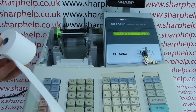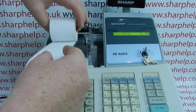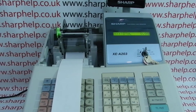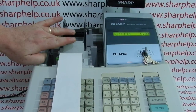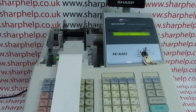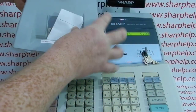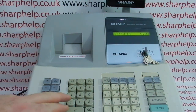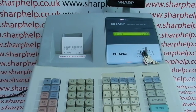The 203 and similar machines have thermal printers and use thermal till roll paper. Load it with the shiny, heat-sensitive side facing down — just drop it into place, there's no fancy feeding required. Then close the platen arm; it should click into place and the paper should feed forward a little. If you're in receipt mode, feed the paper back through the receipt slot, tear off the leftover, and you should be able to re-enter the sale you had to cancel.